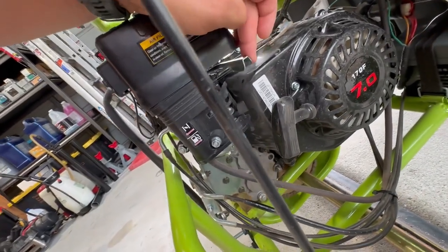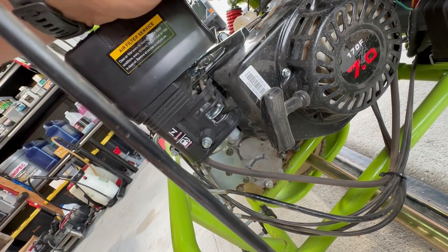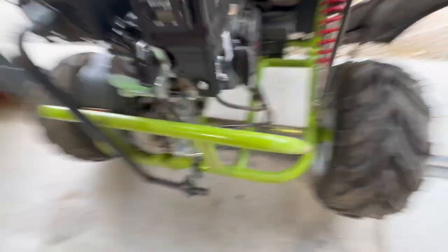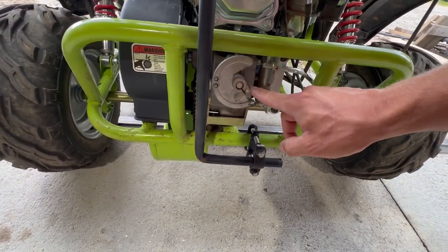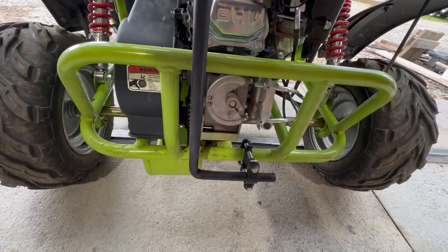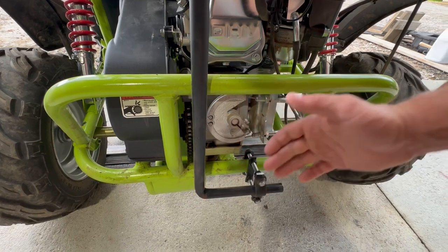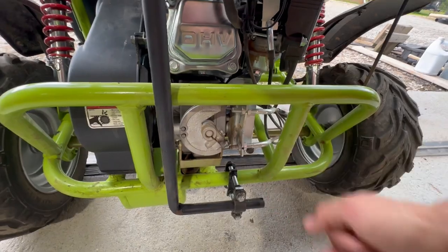The throttle cable is connected right there under the airbox. You loosen a Phillips head screw, pull the tension out with needle-nose pliers, then tighten it back down. For the shifter adjustment, you just adjust the play out of it — you can loosen this 10-millimeter bolt; this thing has little cogs in it so you can pull it out and turn it. In my case I had to add tension because it was loose, so when you put it in neutral it wasn't engaging neutral — it was still in one of the gears. Got it adjusted and it's working perfectly now.